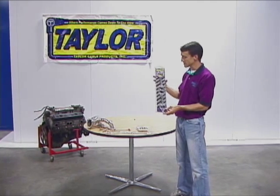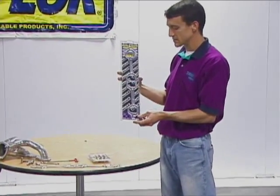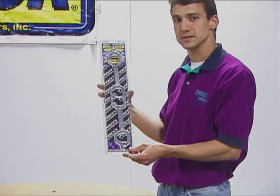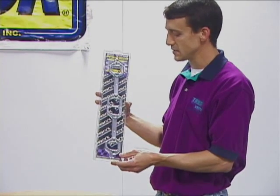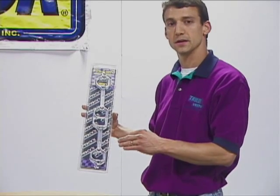They've been around for quite a while. This is the best long-term reusable header gasket solution going. It's made of six layers of ten-thousandths thick dead soft aluminum. This gasket is the only one that's truly soft enough to seal, but yet it's metal and it won't burn or blow out.